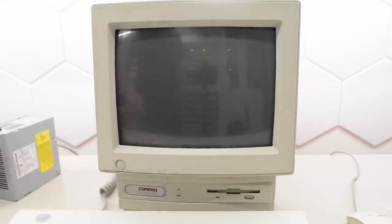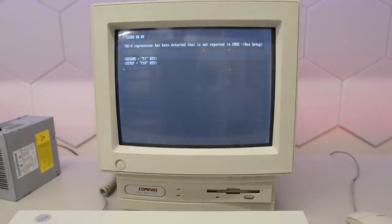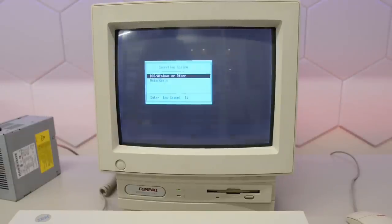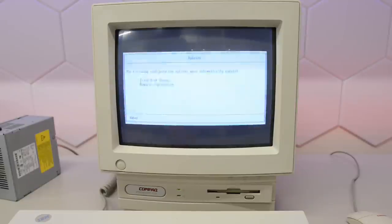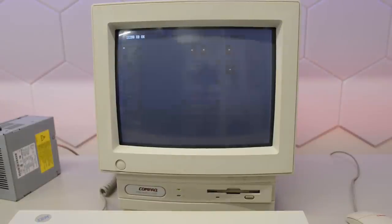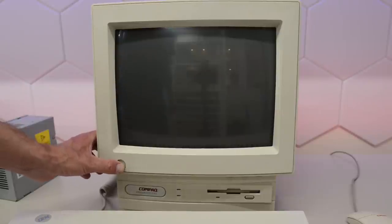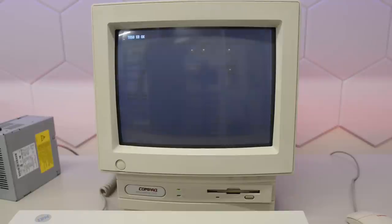Fingers crossed. The hard drive spins up and it's counting up the RAM. We've got an error 702A: math coprocessor has been detected but not reported in CMOS — so let's report it. Now it's asking about the OS: Unix or DOS. That's the first time I've seen that. Unfortunately the BIOS doesn't tell us what CPU it has. Something went wrong and the system doesn't boot — in fact it hung completely. Let's turn the power off and try again. I haven't set the hard drive correctly in BIOS, so that could be the problem.